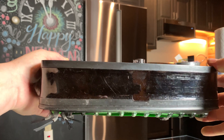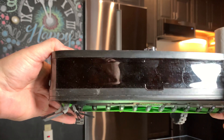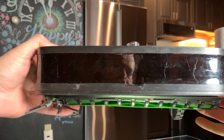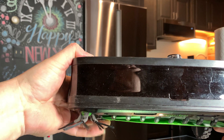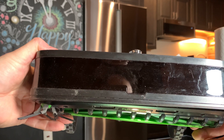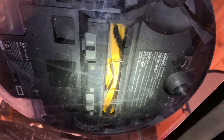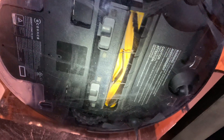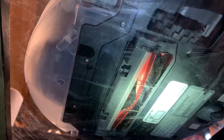Now that we know what it does, let's look at why. The first culprit is the suspended brushes or extractor bars, basically designed to make firm contact with the floor. The fins on the brushes are actually very short, so the body of the brush in some cases makes contact. The Neato D7, which is also D-shaped and has brushes in the front, has little caster wheels on the housing to keep it from pressing too firmly. With a standard lidar robot like the Ecovacs T8 AIVI or a Roborock, only the bristles make contact — the rubbery parts don't — and bristles don't really scratch floors.